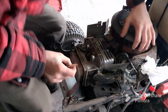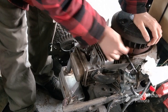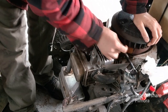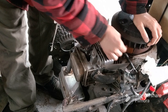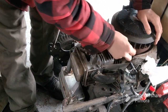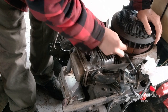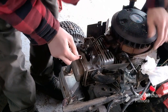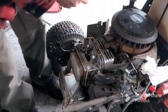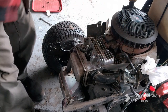While I'm here, I'm going to sand the magnet on the flywheel right here. It is pretty rusty. The mower does run, but this just helps give it the spark it needs. I always do that on most of my mowers when I'm in here. It's not going to be too pretty, but it's shiny now.